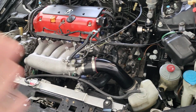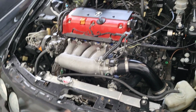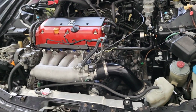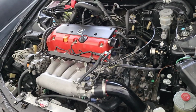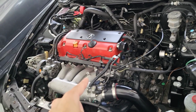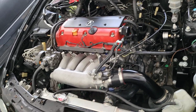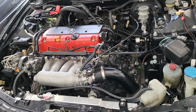But yeah, those are a couple tips to help you guys if you're overheating, or you think you might be overheating, or something's off. Just check those and make sure that all those align. And then the last thing is, if you keep overheating and everything seems to be checking out, you probably have a bubble stuck in there, or you probably have a defective head gasket that could be causing that. So that's another concern in there as well for you guys.